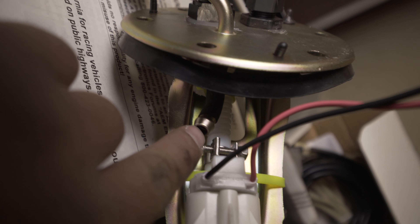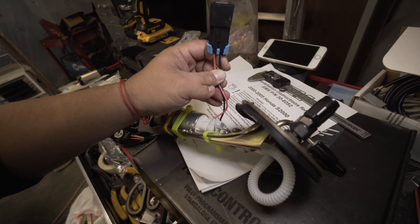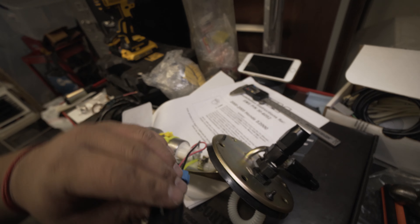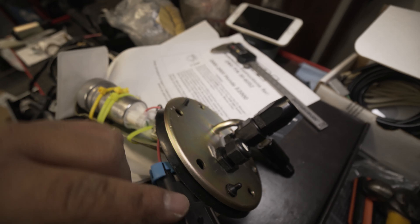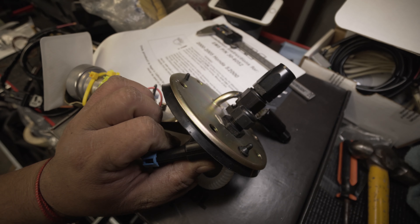When this fitting comes in and then returns back in here, the return line coming back used to shoot directly onto the pump. You've got to stick a screwdriver in there and just bend it to the side so that when fuel comes back, it shoots off the pump instead of onto the pump. That's one thing manuals can't really explain.